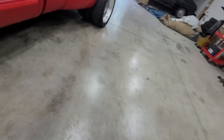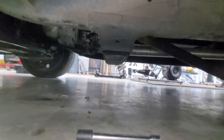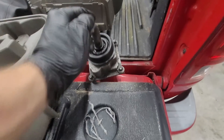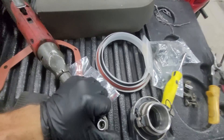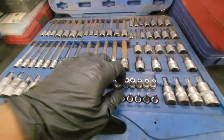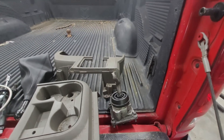With the old stock-ish looking unit — like I said, these are all sealed, so you don't even have to bleed any of these, which is nice. The master and slave cylinder — you can see the bolts right there and down here. Since we're replacing this connector, I just cut them and I'm gonna get that replaced. I need to grab the impact and a couple other things, and then this thing's ready to come out. Got the shifter off — you guys will see these little parts; I never knew what they were years ago, but you want one of these kits. They're a 12-millimeter and kind of a pain. Next step: drop the cross member, get all the bolts out, and pull the trans.